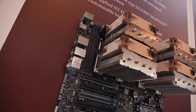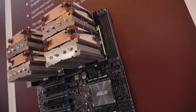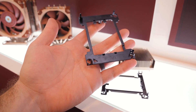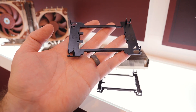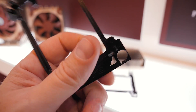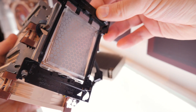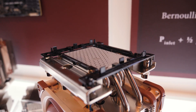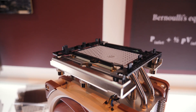As Paul has said, this socket has been designed for enterprise-level system assembly, so it's very quick and efficient for large-volume system integrators. If you're assembling an individual system, things are a little bit more tricky. First of all, you'll have to clip the CPU into what Intel calls a processor clip, and you'll have to make extra sure that these little plastic hatches firmly snap onto your CPU. The next step is to put the CPU with the clip onto your cooler and snap it onto the cooler — it will actually latch to the mounting parts. Once this is done, you put the whole thing onto the motherboard and fix it with four screws.